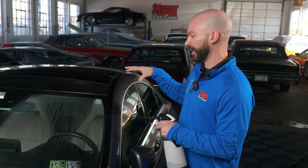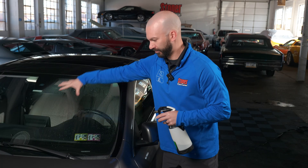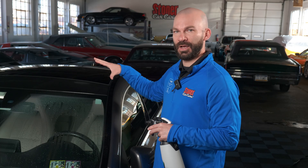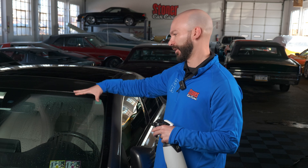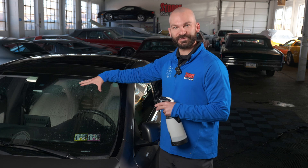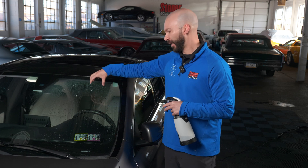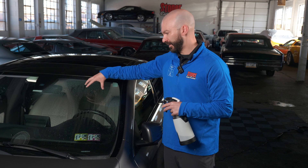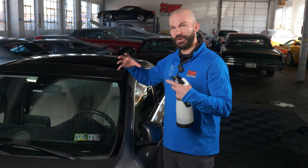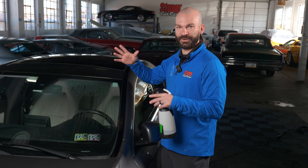When we're talking about beading versus sheeting, on most of this windshield we have a rain repellent coating, which is a hydrophobic coating that creates a low energy surface on the glass. When there's a low energy surface, the bonds within the water beads are the stronger force — they're pulling on themselves, creating nice spherical round beads that can then fly off the windshield very easily.